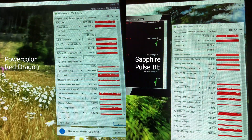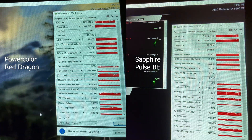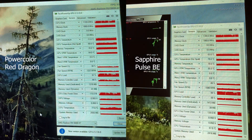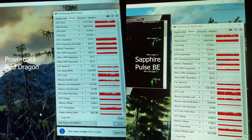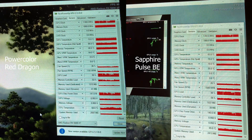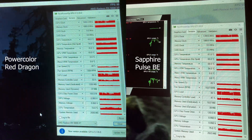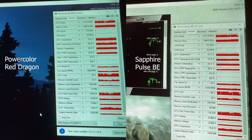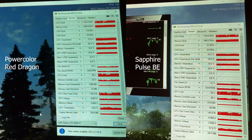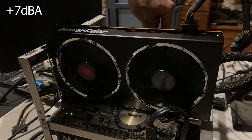As you can see, it doesn't really change anything — the power consumption stays pretty much the same, maybe just slightly higher, and the clock speeds are just a bit higher, from 1730 to about 1780 MHz, as well as the memory clock obviously at 1860 MHz. The temperatures also basically stay the same in both overclocked and stock form, because it's not really drawing more power, and because of that the fan speeds also stay pretty much the same. So there really isn't any meaningful difference in temperature or acoustics when you overclock or not. I don't see why anyone wouldn't overclock their RX 5600 XT, because it's so locked down that it's not going to change the temperature, fan noise, or power consumption that much, and you get a bit of free performance that's pretty much guaranteed.